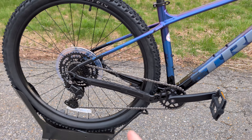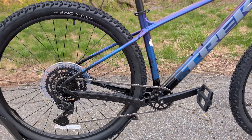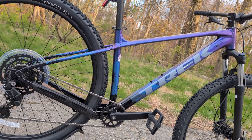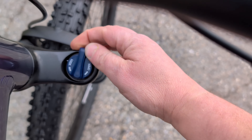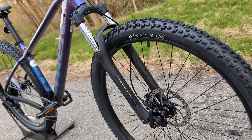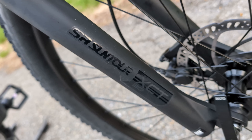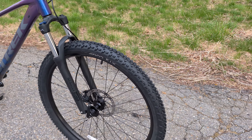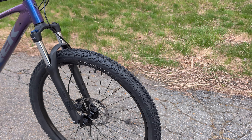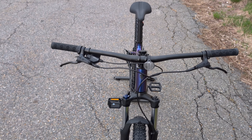This is still a recreational mountain bike, so it's not quite as snappy as some top-end versions like the Roscoe, but we do have a 438-millimeter chainstay length, which is plenty snug and allows the bike to be super playful. The 100 millimeters of front suspension travel on the Marlin 5 still comes with a lockout. It is a coil non-dampened fork — the SR Suntour XCT — which is a place where you might upgrade as you get into riding more, or higher-end versions of the Marlin come with a better quality fork.